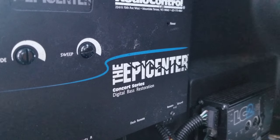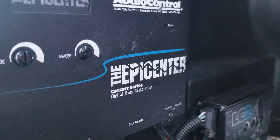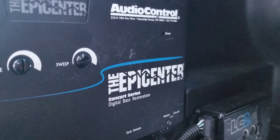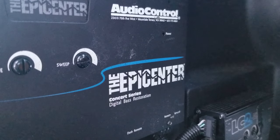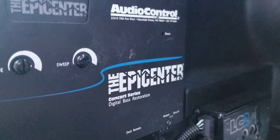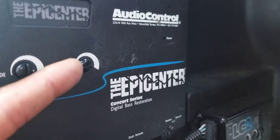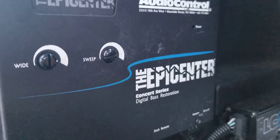It's not adding — it's increasing the information that's present in the track that would normally not be heard. So it makes it seem like it's making your music hit harder, but it's not adding anything. It's bringing frequencies up to an amplitude that you can hear them. So: set the frequency knob between 10 and 12 o'clock with most systems, and set the width knob as wide as possible. Then when you turn the remote knob, you'll hear the effects.